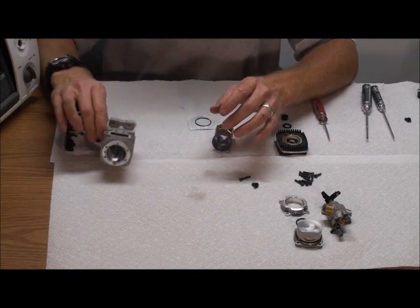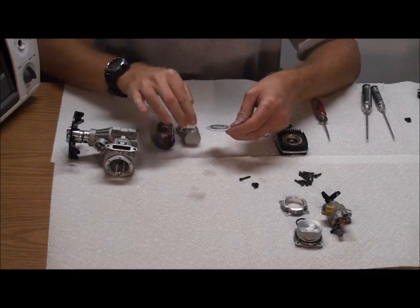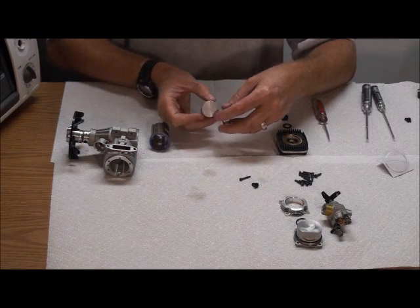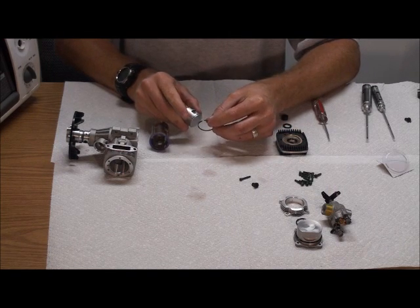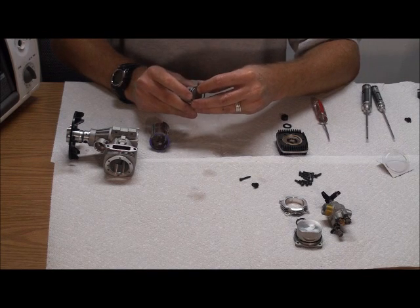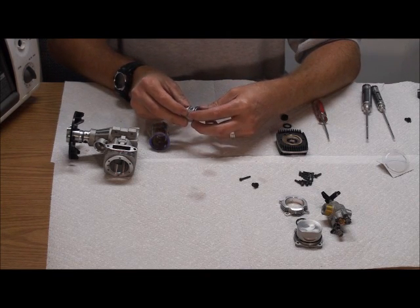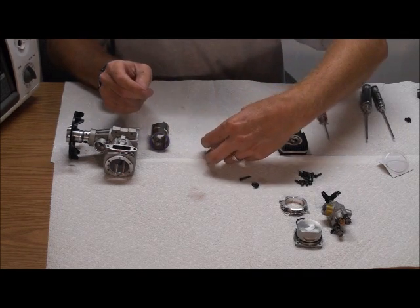While the motor's continuing to cool, I'll set it aside and get the piston and ring ready to put in. I'm going to get the ring onto the piston. The main thing you need to find on the piston is the little pin, which goes with the opening in the ring. I simply lay it where the pin is on one side, hold it with one finger, and go around the edge to expand it until it snaps in place. When you're installing this, make sure that gap stays with where that pin is so that it closes down and stays in the right spot.